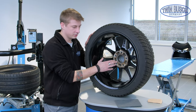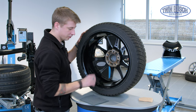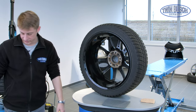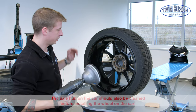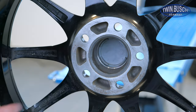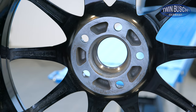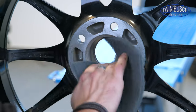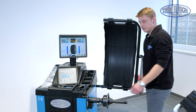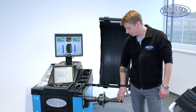There are also many options to clean the wheel plate: fine sandpaper, a cleaning pad — just remove the rust to get a flat contact surface. If this is too much work by hand, tools can be used. Here we have an electrically powered cleaning pad. We also remove the centering ring and the cover cap so that we can later slide the wheel onto the shaft of the wheel balancer — the surface should also be cleaned here. After checking the wheel for damages, cleaning it, and polishing the contact surface, we can finally focus on the machine.